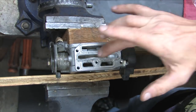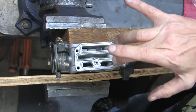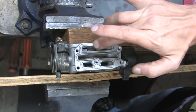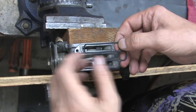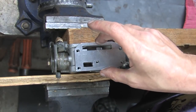You have to use a new OEM FIAV gasket on the throttle body side of it and an extremely thin coat of RTV to the flange on the fast idle air valve side of it. All 1991 to 1999 cars use the same block off plate and gasket. They cost about $35 combined. 1990 cars require a different procedure that's completely free, and I've linked a great concise and to the point video of it being done in the description.